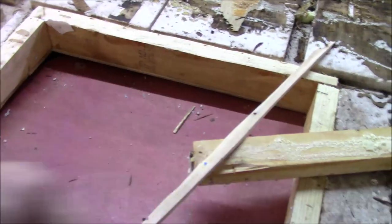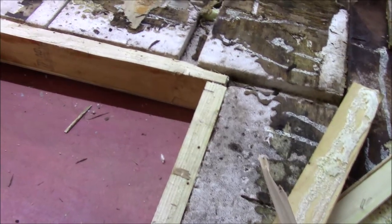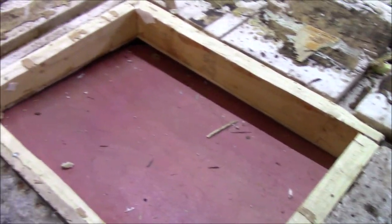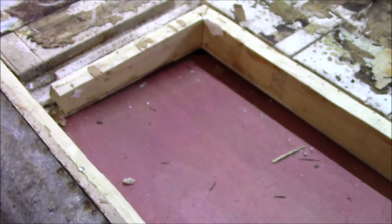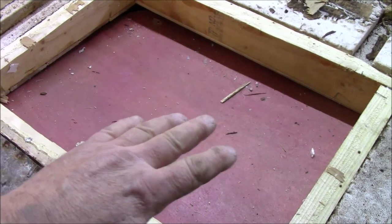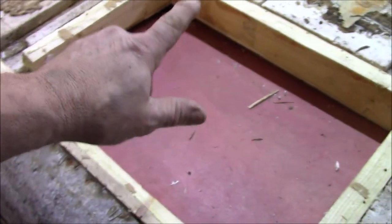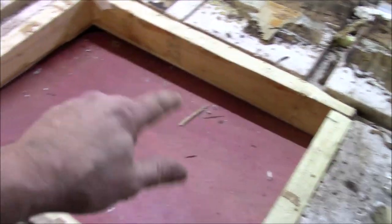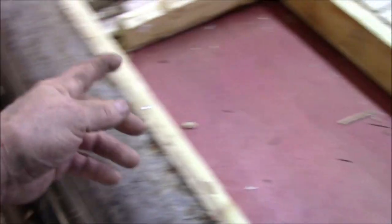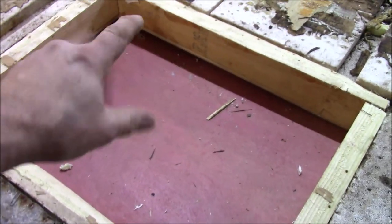A lot of times it's a compound problem. The seal around these skylights — Dicor wants you to keep putting more on, and I joke that putting more on is just 'more on,' because the system is terrible. Dicor exploits people's ignorance of roof systems and cons them into buying $14–15 tubes and slobbering more on every three or four months — that's ridiculous. The other problem is with the lens on a cold morning: condensation forms not just on top but also on the interior. The foam acts as a thermal barrier, but something like this skylight with no thermal barrier will see condensation weeping down and rotting out around the ceiling — it's pretty common.